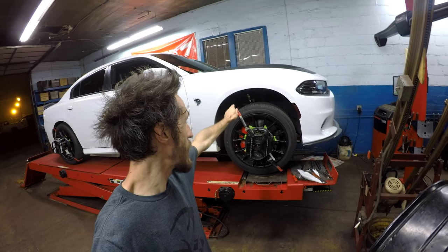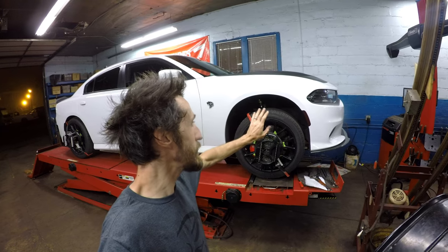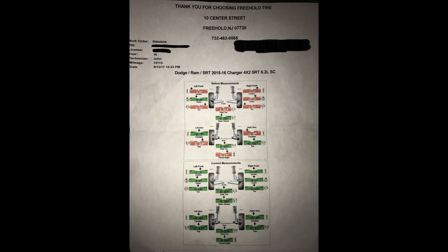Make sure to torque down the top spindle nut to 120 foot-pounds, and once you do that you are all done — once your alignment is right where you want it to be. Big thanks to Vicki at SPC. Hopefully you guys found this video helpful. As you can see on the screen, the alignment is perfect — we actually tweaked a little more and got everything to zero, with all toe at 0.10. The top measurement was just the initial reading after settling the suspension, so pay no attention to that. Don't forget to hit subscribe and the bell notifications. I've got a Scat Pack Charger and Daytona Charger review coming, a Best Sedan in America review between the Genesis G80 and Dodge Charger SRT, and a Jeep SRT and Durango SRT review coming as well. I just uploaded the Mustang 5.0 review. Remember, be sure to subscribe and share the channel, and until the next video — have fun and be safe.